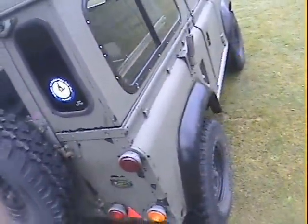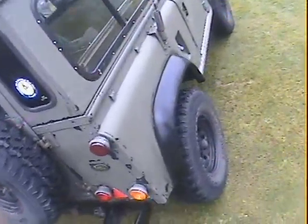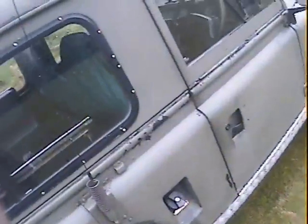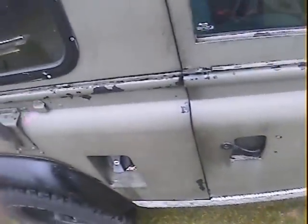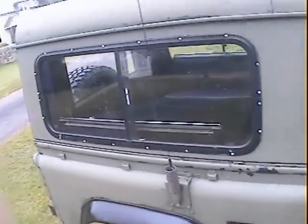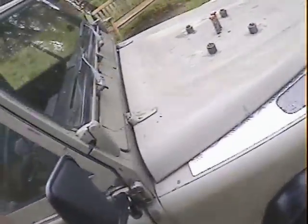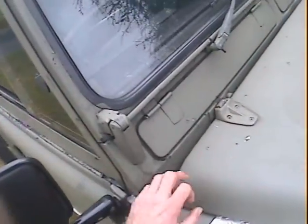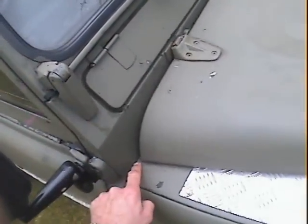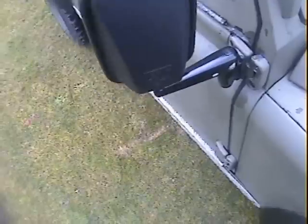Paint loss on the offside rear quarter. Looking down the offside, it looks pretty straight. Offside rear wing, all good. A few diesel stains here. There's a large area where the black is showing through just there and on the tub top trims. Driver's door, all good. Driver's scuttle corner looks great — no problems there at all. There's a tiny bubble just coming up at the bottom where the wing touches it, and a little bit of bubbling and cracking just coming up on the A-post, but otherwise all good.